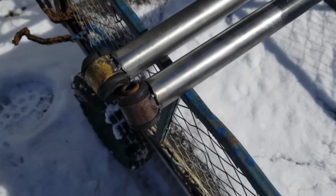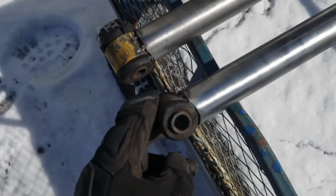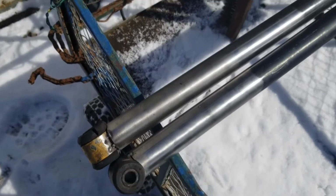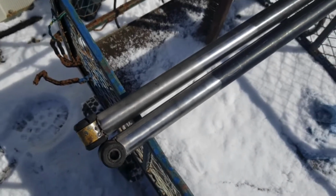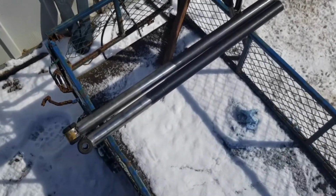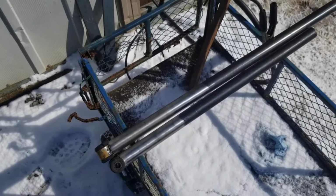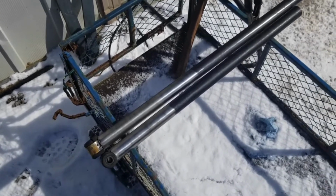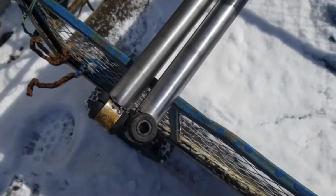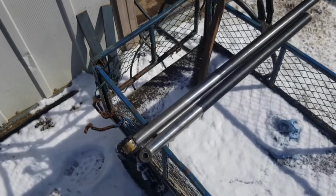So I just tacked up the bushings. This is going to be on the axle side, and it's going to be bare metal with clear coat on them. So I've got to measure to length, but I'll have to do that when it's on the ground, when the suspension is loaded. So I'll wait to do that. But they're tacked on, and then I'll weld them on fully. And I'm probably going to do TIG welding on them, so make it look nice.